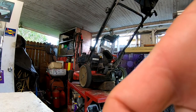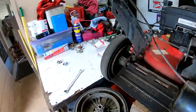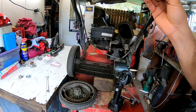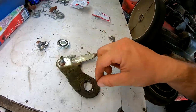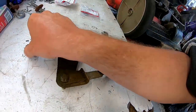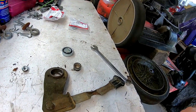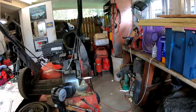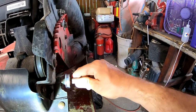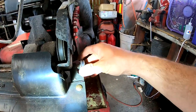It is easy to pull this off. You've got these eight-millimeter bolts here — they zip out, more like a screw really — and then you can put your new one in. You can see, I was wondering why I was getting kind of a lollop sometimes, and that was just the ball bearings gradually disintegrating. This is an easier job than I expected; really happy about that.